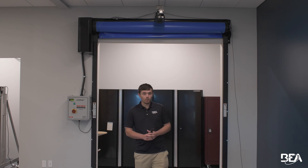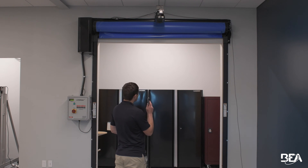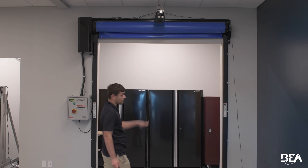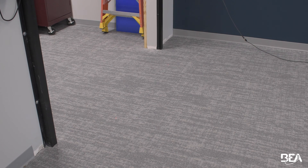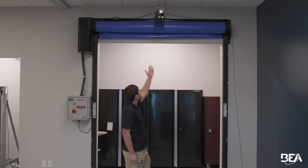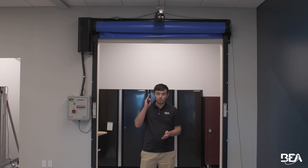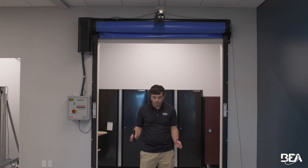What is E5 flatness? The wide scan, when you're doing a teach-in and trying to align it, there are two visible spots that come on the ground. Between those spots and out just a little bit, it's looking for flat ground. Whenever it's not flat — say there's a water drain, graded flooring, or the cover is down — the lasers will be shooting flat in other spots, but then there are discrepancies in between them.